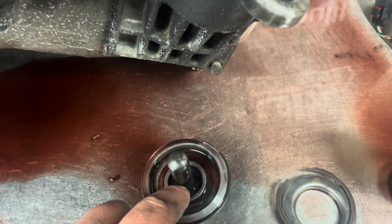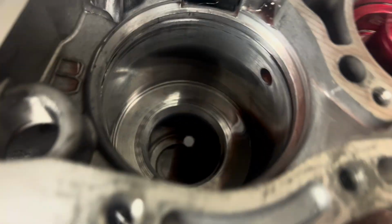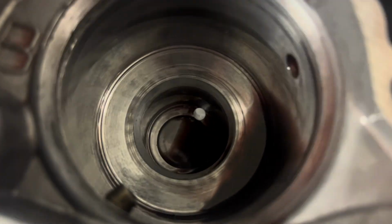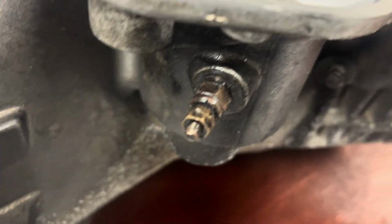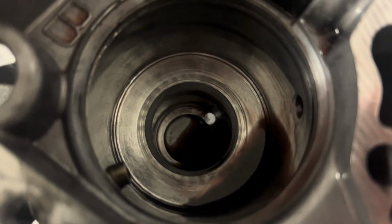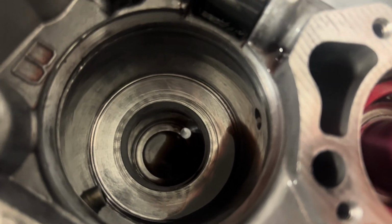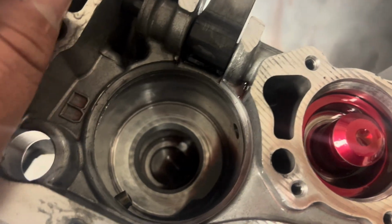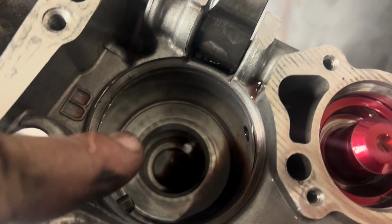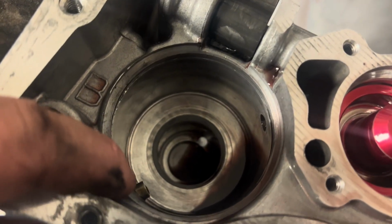I was trying to depress the front servo cover to get this apart, and it wouldn't do it. And I realized this sensor is too long. And so when this thing is screwed all the way in, it actually had this front servo spring coil bind. Now this was a stock servo spring, so if you had maybe like the Transgo style spring or the gear end spring I had in here, maybe it wouldn't actually be a problem there. But this thing was actually hanging up the spring.